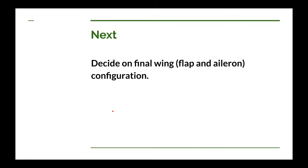That's enough talking about ailerons combined with flaps. The next thing to do is actually decide on the final configuration of the flaps and ailerons for the wing. Previously, I had spent significant effort trying to figure out if I wanted to do full span flaps — I'm starting to back off on that idea. I will generate one more video on this airplane wing where I give a final decision on what I'm going to do with the flaps and ailerons. I want to get far enough along in this design that I can start making a few parts this summer. I need to rapidly get on to figuring out the mean aerodynamic chord once I get the flaps, ailerons, and wing size figured out. Once I have that, I can figure out the moment arm of the wing and then get to working on the horizontal tail, and then the vertical tail.